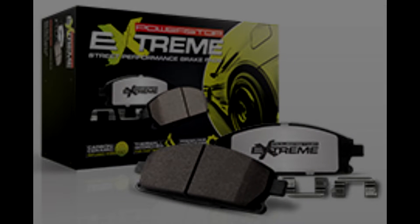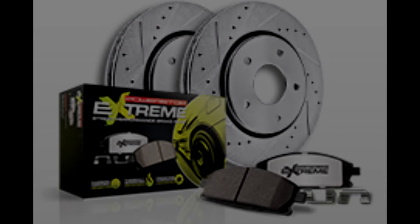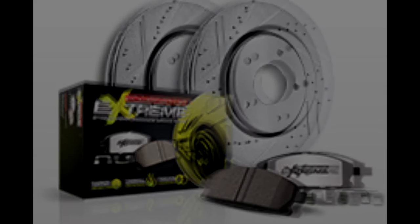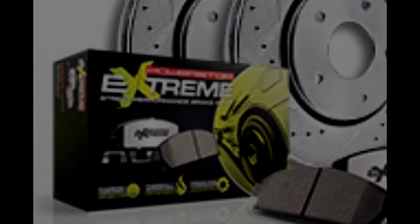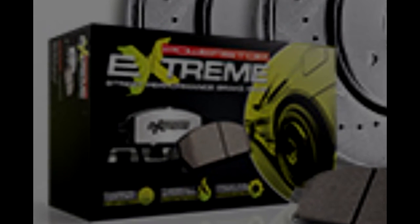The next kit is the Street Warrior — it's a K followed by a number slash 26, so 26 equals Street Warrior. Those pads are for high-performance street drivers, best suited for high horsepower cars or if you've upgraded to bigger wheels. It's a carbon fiber ceramic hybrid, resists fade up to 1,500 degrees, and the stainless steel hardware kit is also included.